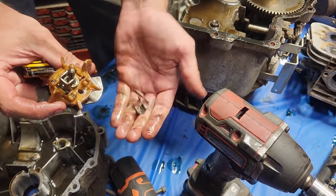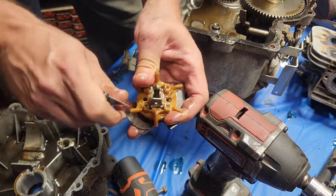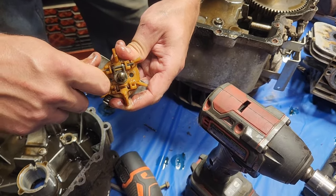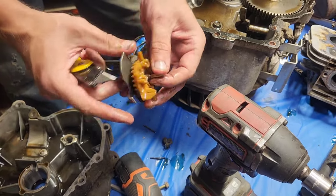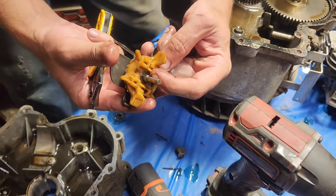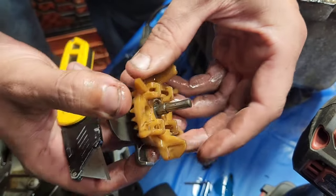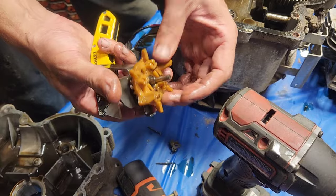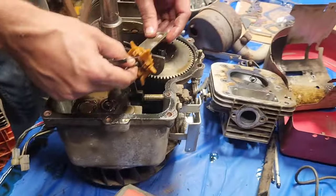Once you cut it, you can slide the pin — and that takes the whole assembly off without having to monkey with anything. Do that again on the other side: cut that notch there, cut that notch there, flip it, push the pin, pull that out, drop that. Check that yours has a collar that is in place. This collar here is pressed on and will not move. Some of these have a collar over the top of a hog ring if they're a replacement from China. This one's an original Briggs, so it's got the original part.